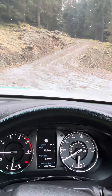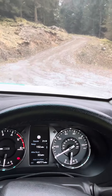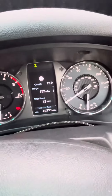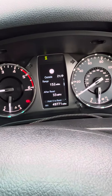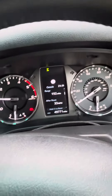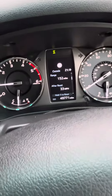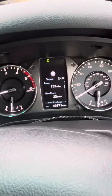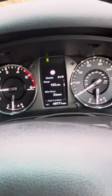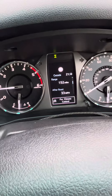To do a nice controlled climb up here, I need to put the vehicle in four low. To do that, I turn the dial here from two high to four high and wait for it to go solid. Sometimes it might not go solid straight away — I'll just roll forward and backwards a little bit. There we go, so now we're in four-wheel drive. I need to do the same again: turn this knob to four low, which turns quite a lot of stuff off, and it's going to beep at me.